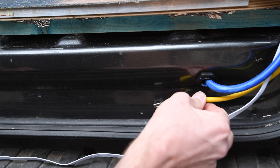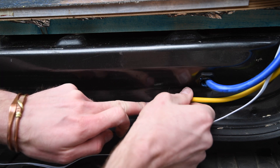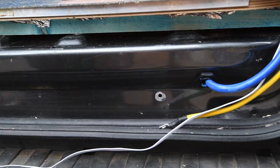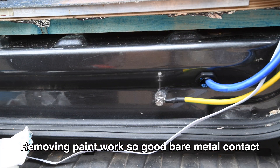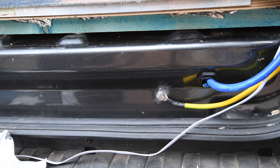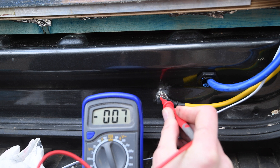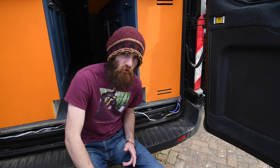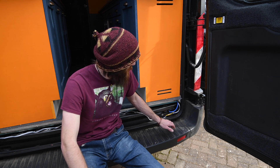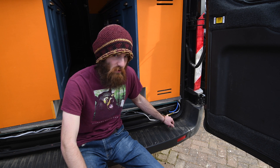Now that's for my earth point. I'm just going to do it here. The main reason is: one, so I can keep an eye on it and visually inspect it occasionally. And it's the same cavity as this, so I can actually access the back of it to do the bolt up. Let's do a pilot hole there. I'm going to put a locking nut on the back of it as well. Secure earth point done. All being well, there should be continuity now anywhere I touch on the chassis. I'm going to go to the rear door lock — there we go.